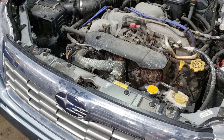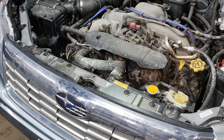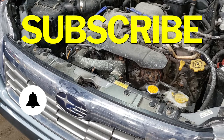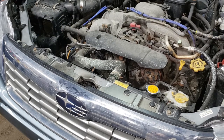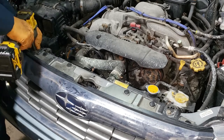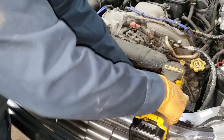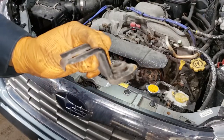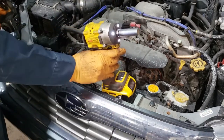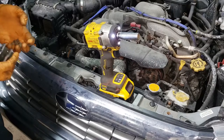With all that out of the way, we can go ahead and start removing the radiator. Before I get started, do me a favor and subscribe to the channel and hit the notification bell. Now let's get started. First thing you're going to need is a 12mm. Grab your 12mm and remove your radiator clamps — the bracket that clamps your radiator to the rad support.